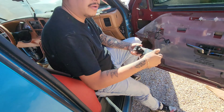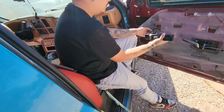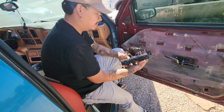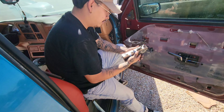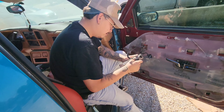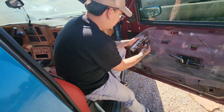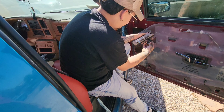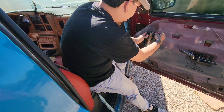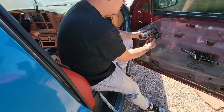These are the switches off the door panels I have over there — they should just be plug-and-play. The only difference is these came off a Tahoe and these doors came off a crew cab, so there might be extra plugs and extra buttons. This one looks like it does plug into here — yes it does. This one on the back — it does too. I think this extra one is for the power folding mirrors, or I don't know what it would be for.